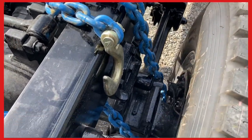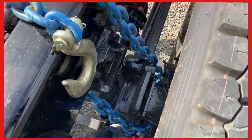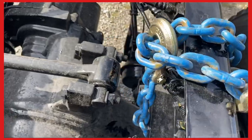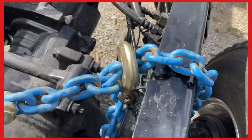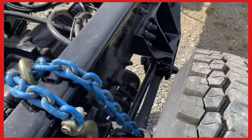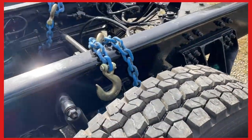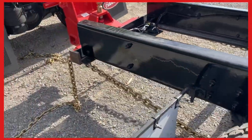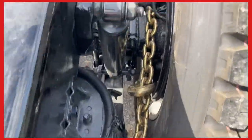You gotta chain these. I dropped all the air — this truck had air — so I dropped it, wrapped a chain around the axle, being as careful as I can to not let it touch the shock. This part's just loose so you can see that works out really good. If this wasn't a dump truck, since I'm moving new trucks, I would have put a little rubber pad under there, but this truck's gonna get a box.